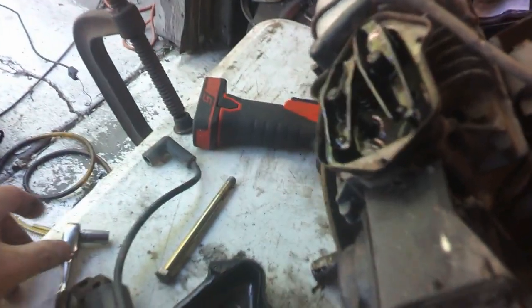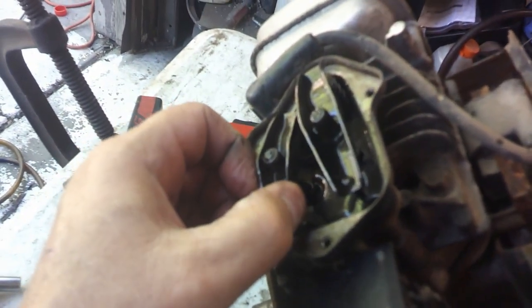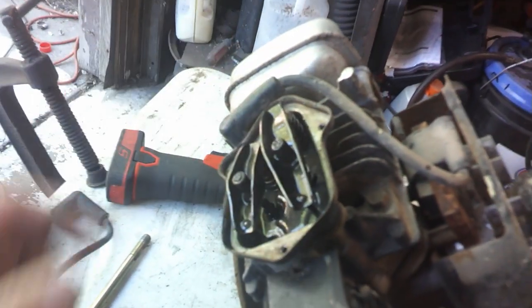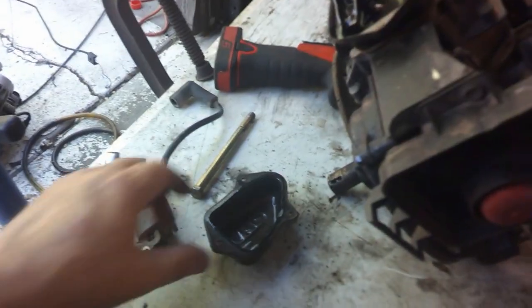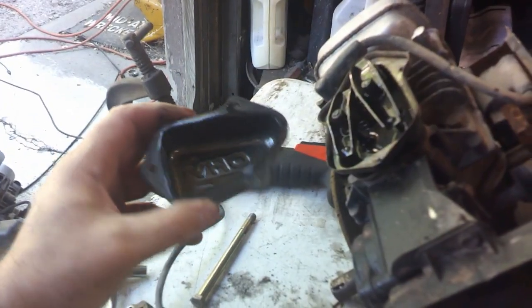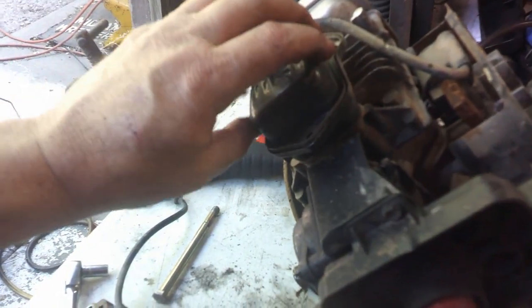I wouldn't even worry about a feeler gauge myself, but just a little bit. That probably run a little bit better. And if it doesn't, I can back them off just a little bit. Real easy to do. Just a valve cover. Just pull it off. It's got 3 bolts. Just away you go.